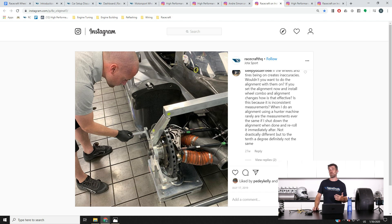The important part here — if we're dealing with a road car that has been converted to a race car — we're generally going to end up with our damper or shock absorber somewhere in here. With a setup hub we've got access to making ride height adjustments as well as toe adjustments without needing to take the wheels on and off the car or jack the car up and down. Those setup hubs are unfortunately cringingly expensive in most situations and a little bit outside the scope of the average weekend warrior or home enthusiast.